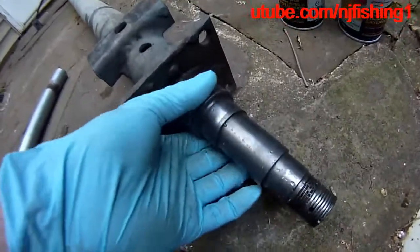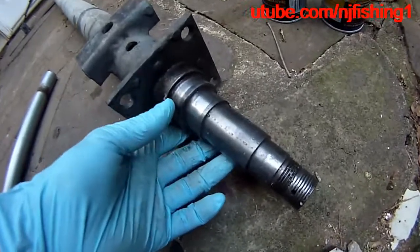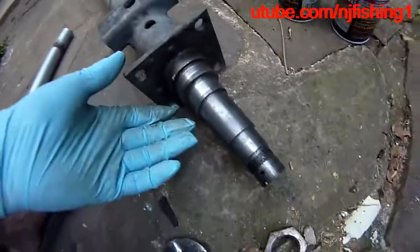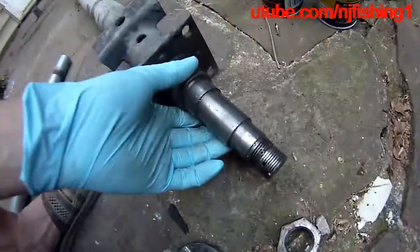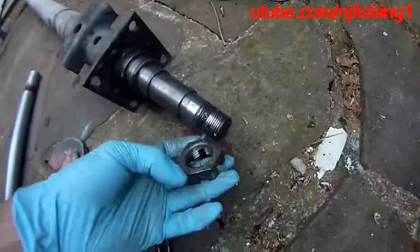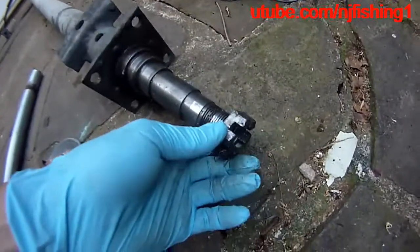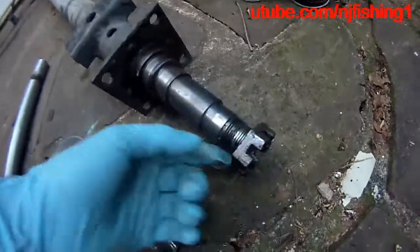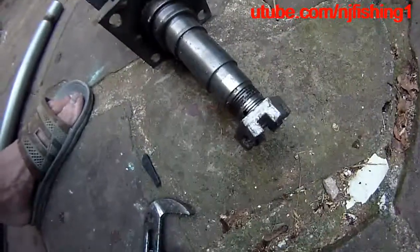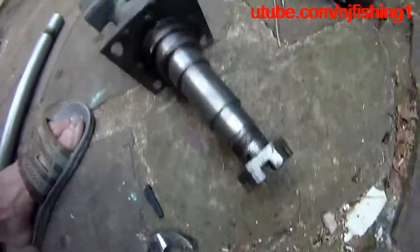You can easily buy the spindle anywhere at a trailer parts store. I may or may not bother with cutting and welding — it depends on whether I can find someone who has experience with this kind of work, because it's an important job and not something the average person can handle. At least the castle nut is out. The spindle thread is burned and destroyed, but at least I was able to reuse the wheel hub. I'll be replacing the inner bearing, outer bearing, inner seal, and outer seal — and get a new axle with a new castle nut.